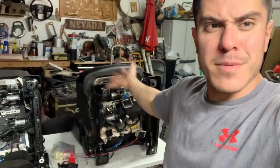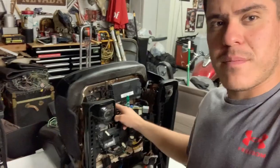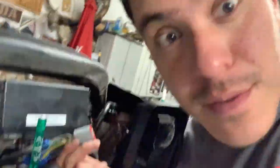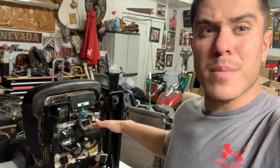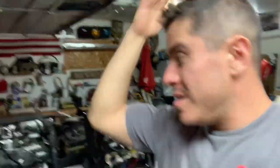Important warning: after you bypass the memory module, do NOT plug your plugs back into the memory module — leave them unplugged. I'm serious. If you plug them back in, things start burning up and getting very hot. Learn from my mistakes — that's how I know. So leave your stuff unplugged after the bypass.